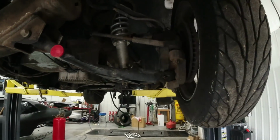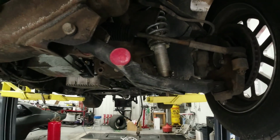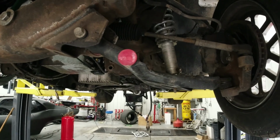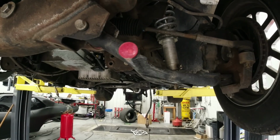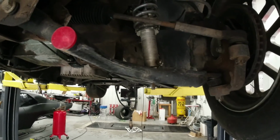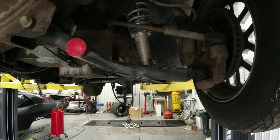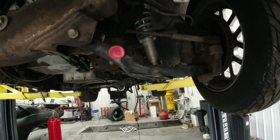I did change up the front suspension a little bit. Everything's still in factory location, but I did use a DJM 4-inch drop A-arm with a 2-inch drop spindle, and I got coilovers on the front that use the Atomic Fab coilover bracket relocation. I forget what he calls it, but it's got coilovers on it. Probably change those up this coming year, put something a little better on it, or I may not. I don't know. Depends on the kind of money I get.